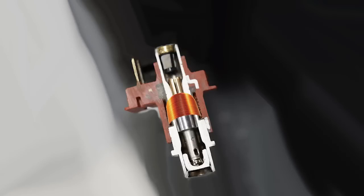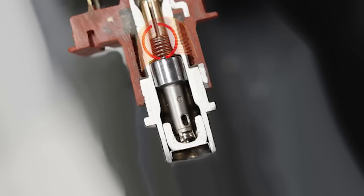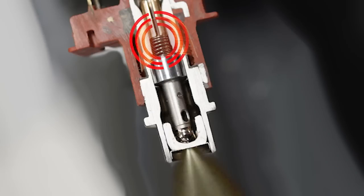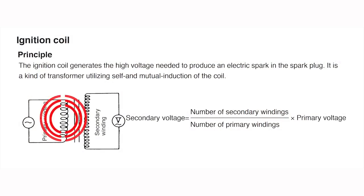You might be surprised to see 90 volts out of that little injector — how is that possible? The injector contains a coil of wire wrapped around an iron core. When voltage flows through the coil, it creates a magnetic field that pulls the plunger inside the injector up, allowing gas to spray into the engine. When the ECU opens the circuit, this magnetic field collapses and a spring closes the plunger. This rapid collapse of the magnetic field induces high voltage back in the coil — this is self-induction, the same principle as the primary circuit of an ignition coil.